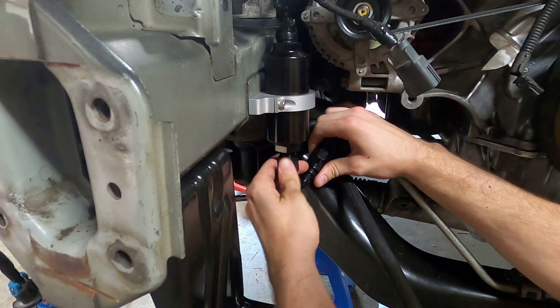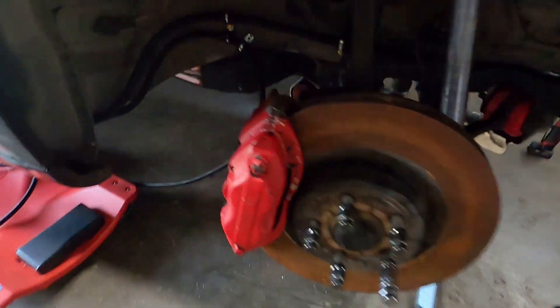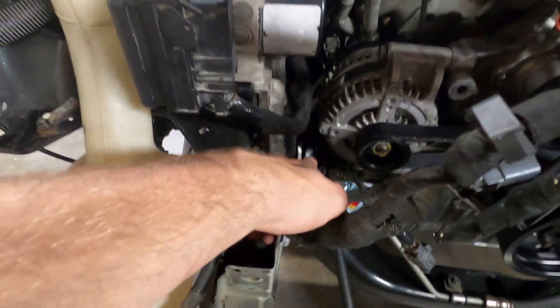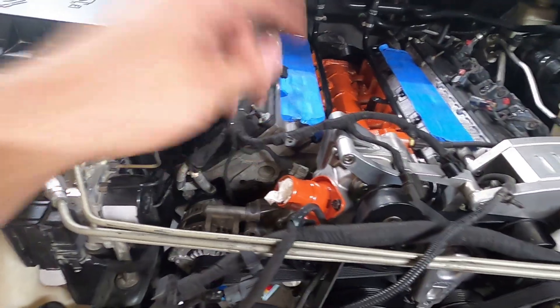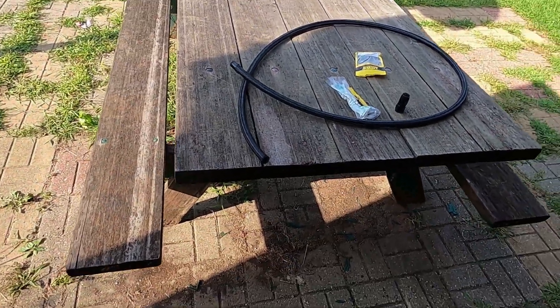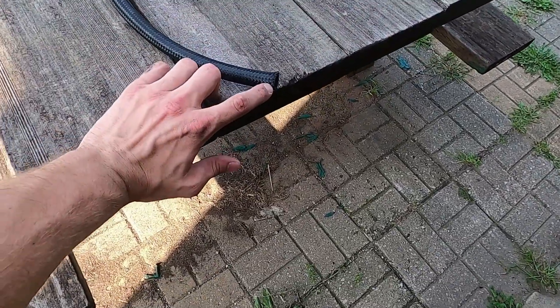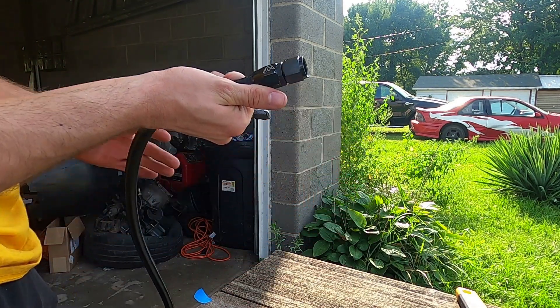Gave a little bit of slack so I can move it around when I install it - I think that'll work. It's going to be tucked in there; sorry for the bad view but it's pretty dark down there. Looks pretty good - I'm going to zip tie it to the brake line so it doesn't chafe. Even though I don't have my fuel rails and intake manifold installed, I'm going to do one side of this fitting going from the fuel filter to the fuel rail. I'll use the excess dash 8 hose and throw a little bit of tape on this first. If you're ordering AN fittings from JEGS, here's the part number for it.